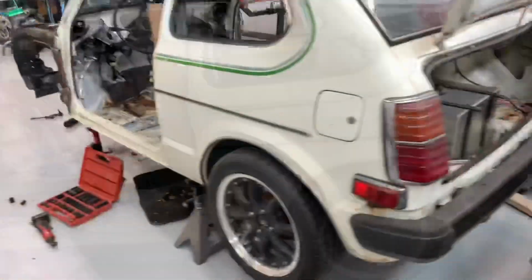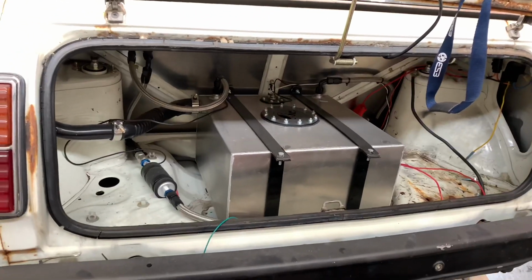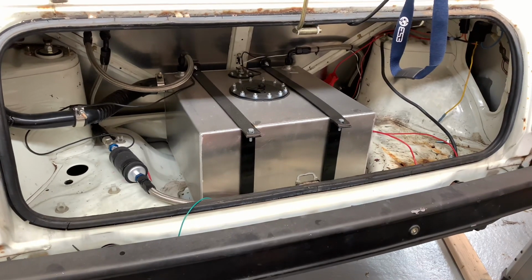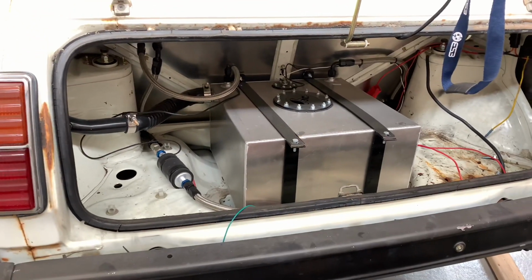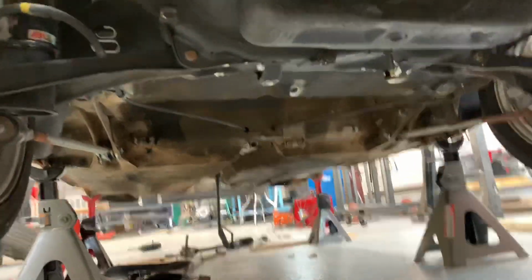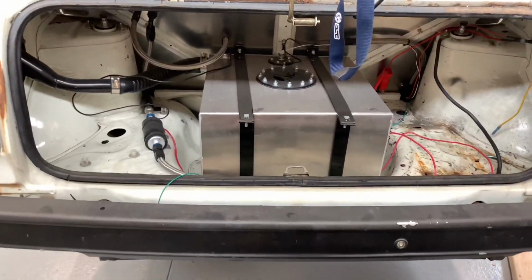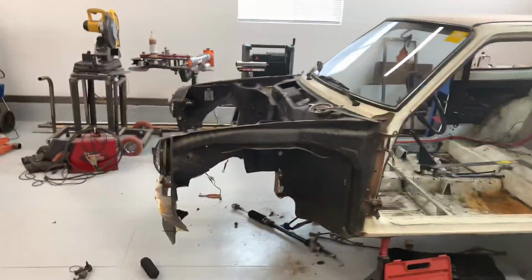because the suspension on this car factory is just garbage. The next thing I upgraded, obviously, since I went to fuel injection, is the tank. The tank in this car did not breathe well. I did everything to it. I sumped it, it didn't work. I had it sumped, and then I put a vent pipe on the top. It kept starving for fuel. So I end up having to put a fuel cell in the car. You can't fit anything underneath. There's like no room underneath there. Well, there is now that the tank's gone, but I end up getting a fuel cell, doing the Walbro 255 pump, all AN lines. So that's how it sits.